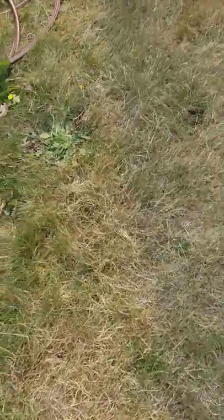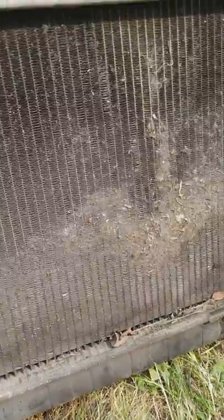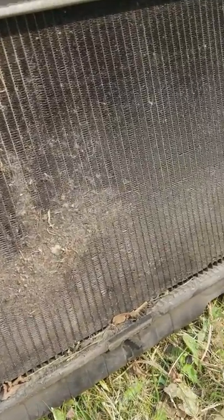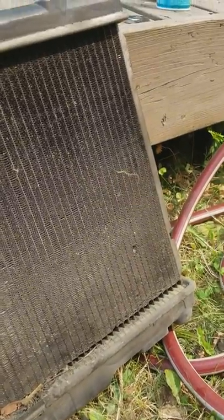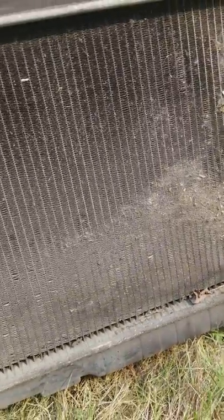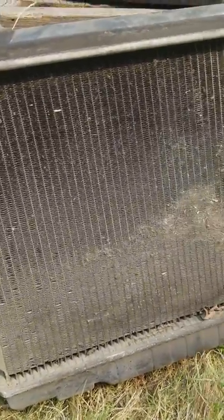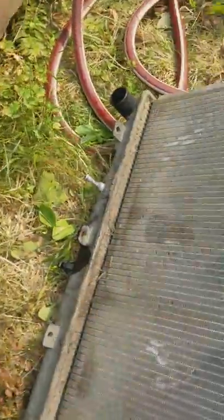So I brought it back, pulled the radiator out, and I'll show you what it looks like. This is the front side of the radiator — the side that faces the cold air as you're driving — and as you can see, it is just caked with dirt, dust, and road debris. This was causing air not to be able to get through the radiator and cool the engine. You look at the back and it's clear.